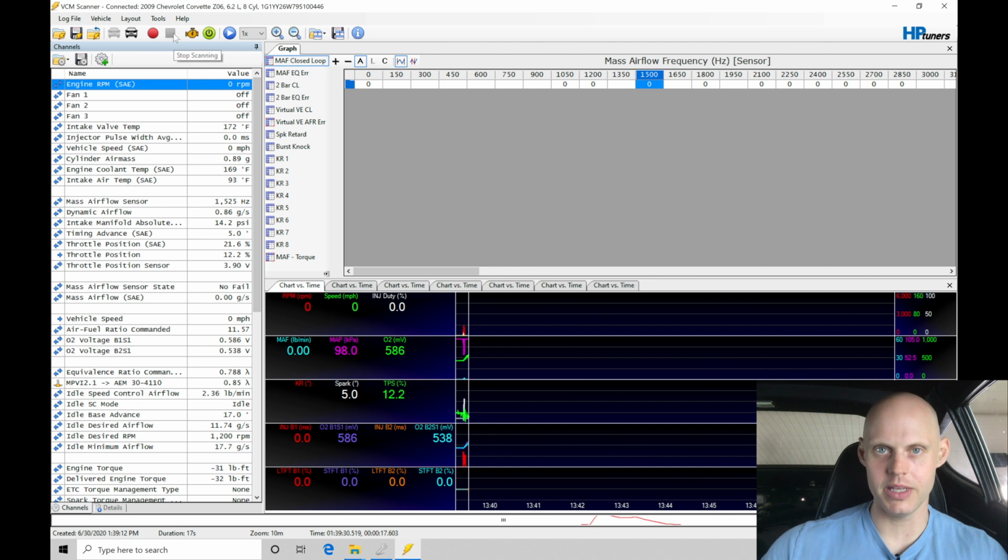So this now leads me to what we need to take a look at next. This is all part of the idle control routine. So we're balancing. In this video, we're bouncing around a little bit. You'll find that you need to deal with your injector scaling right off the bat, and you need to deal with your idle control. So it's going to be one and the other. Now in this situation where I've started up and it died, that was an indication that my startup airflow isn't enough as my coolant temperature is getting hotter and hotter.